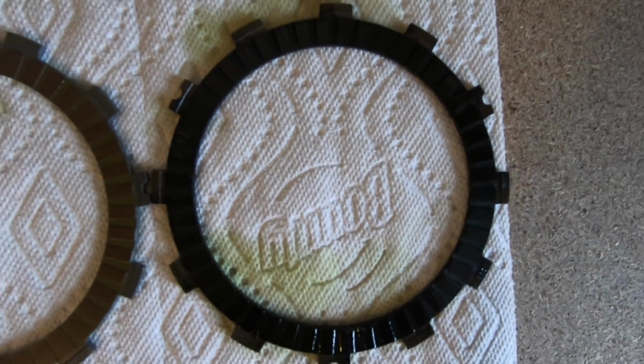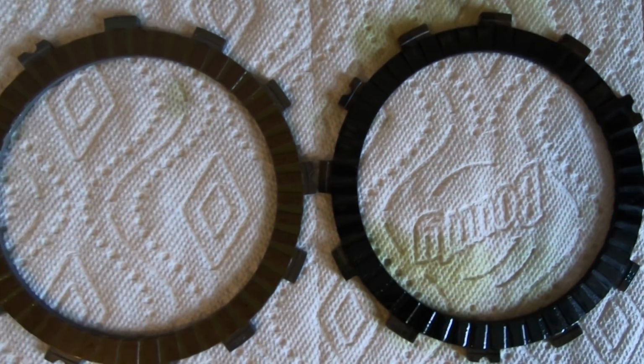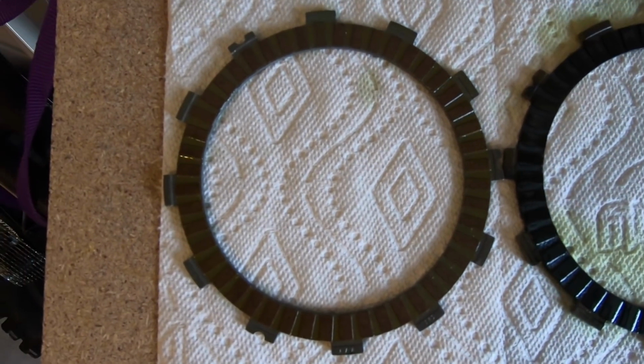So I just put a fresh clutch in, have the stiffer Hinson springs. I'll let you guys know how long that one lasts for. I'm hoping to get about maybe 12-15 hours out of it. That seems to be what I was getting out of my old bikes when I would put the stiffer springs in. If you go full Hinson clutch, I know that is even better, maybe gets you like 20, maybe even 25. So yeah, because of that, definitely I would recommend immediately when you get the bike, Hinson clutch springs.